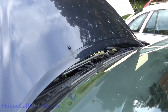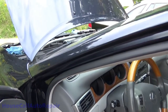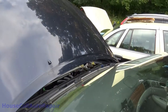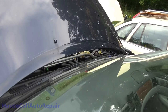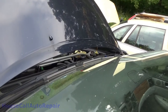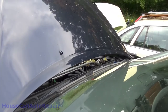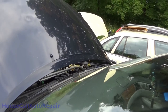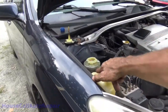One side and just keep an eye over there and all the way back. And just keep an eye on your fluid level. And back up, see it came right up to the top, and go back the other way. Don't get going too fast with it or you'll spurt the fluid all over the place. And repeat and refill and repeat and refill, and do that a few times. You'll get your fluid to start to level off and stay right up in here.